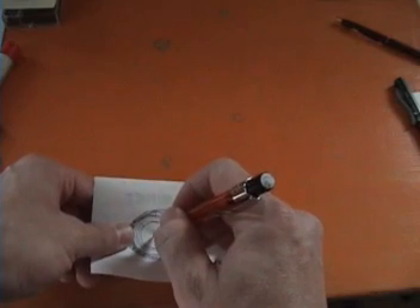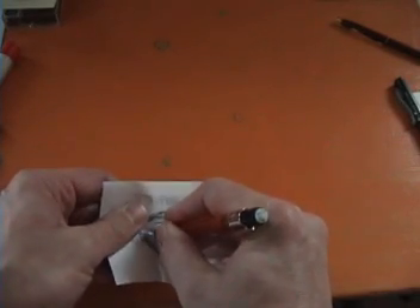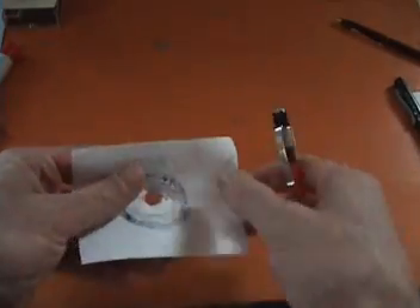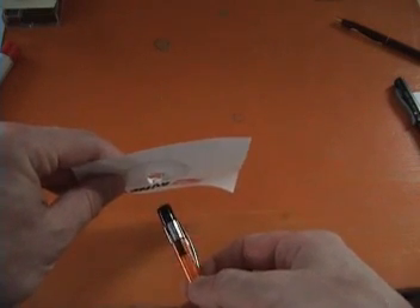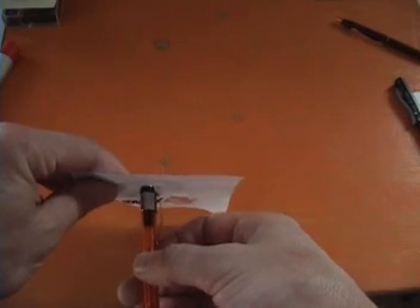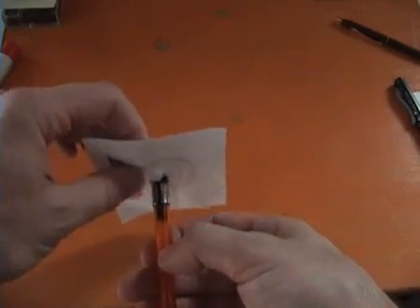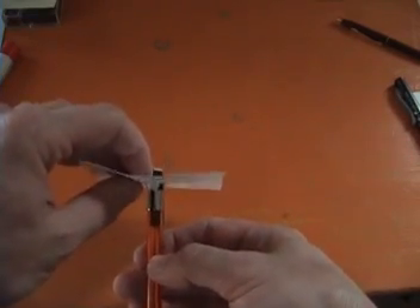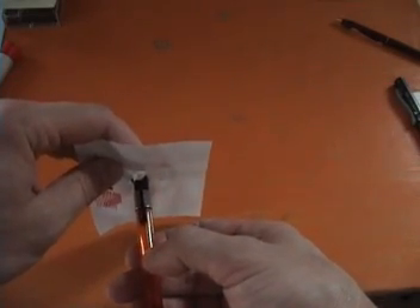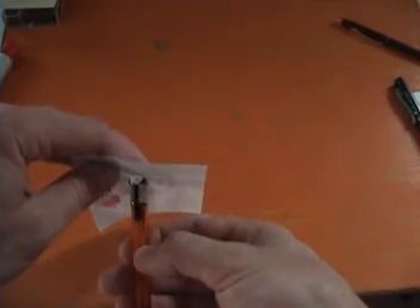The tendency for the seal is to roll. What we have is this — the seal when it's broken in and stretched into place — and what they want you to do is put it on the front crank seal without letting the lips of it roll backwards. So it's very hard without the special tools. It's practically impossible to take this seal, slip it on, and then hammer it down and drive it.